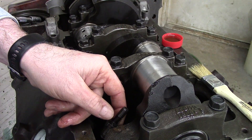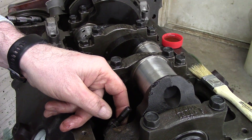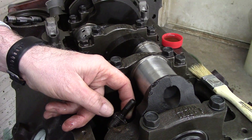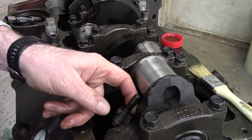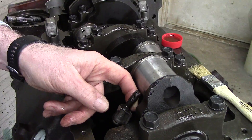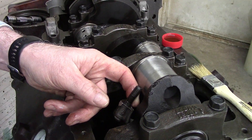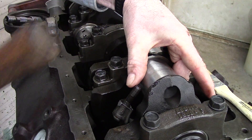Use the back of your hammer to slowly bring the piston up into position, tapping on it and watching the rod surface so that the rod bolt does not touch the actual bearing surface on the crankshaft. When you get it fairly close, you can stop and hold it.